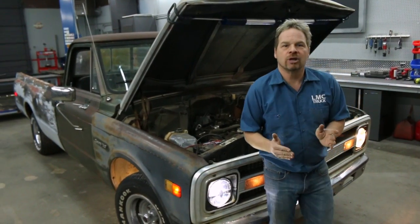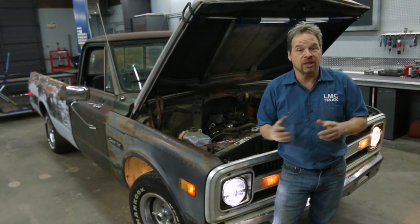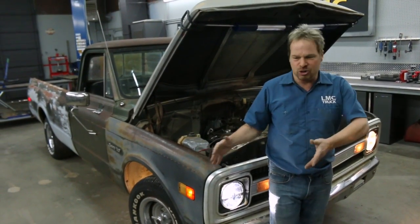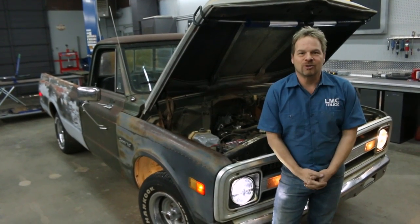The one thing I really want to drive home is to make sure your ground connections are solid and well connected, because 90% of all electrical problems come from a faulty ground. We hope this video has helped you with some techniques on how to take that yellow dingy lighting away from your old antique truck and bring it back into the 21st century.